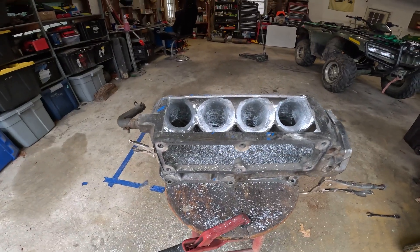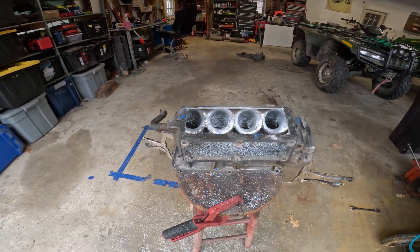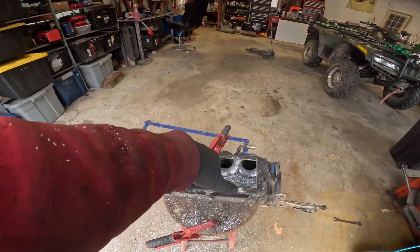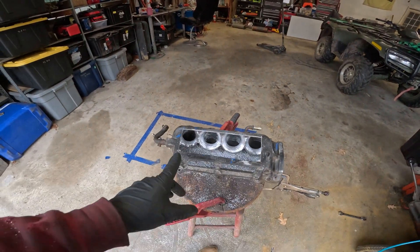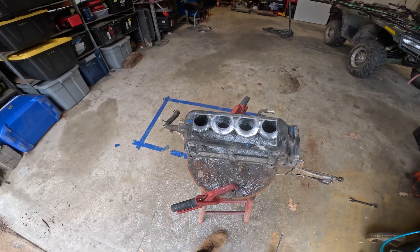Here's what we've got so far. I went over on a couple spots in the middle, but it's opened up a few millimeters more than factory. I don't really have the tooling to get deep down in there, so I'm just going to clean all this up, clean up the inside, and then open up the throttle body.